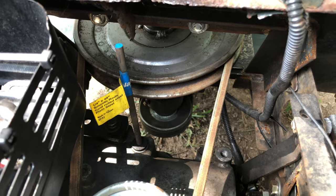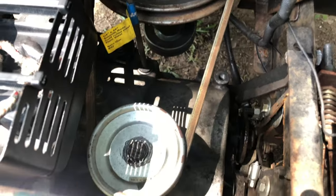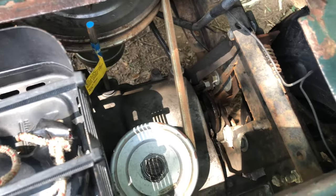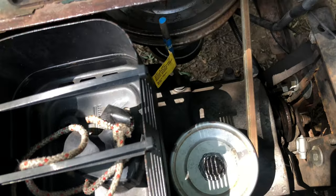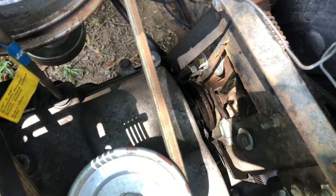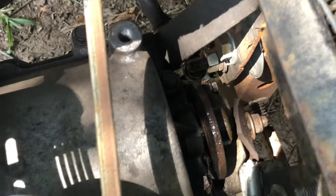You can see the bottom pulley of the jackshaft that goes to the engine, and the top pulley runs to the transaxle. This thing has a massive overdrive ratio — I'm pretty amazed the transaxle is holding up to the speed. When the engine's running, this pulley spins roughly 9,000 to 10,000 RPMs. The belt on this section is a half-inch belt. You can also see the original transaxle brake that the blade engagement lever works — I'll need to fix that soon.